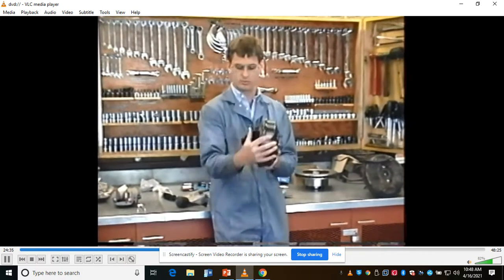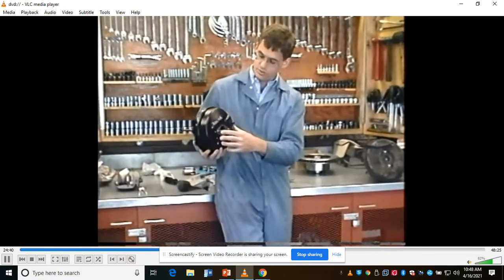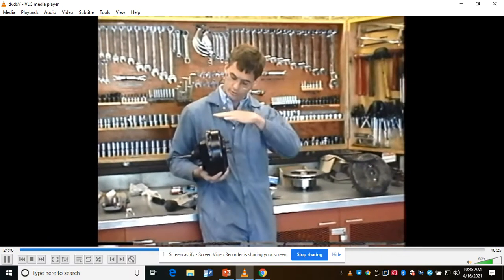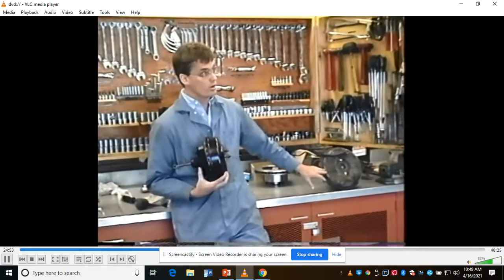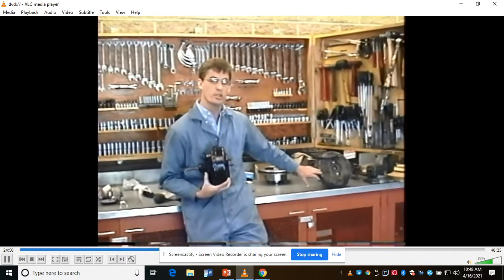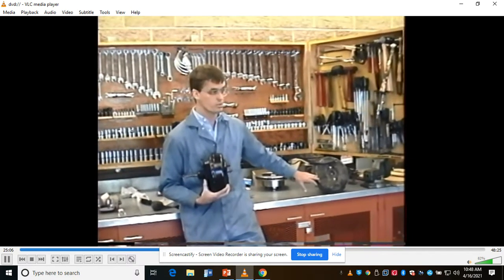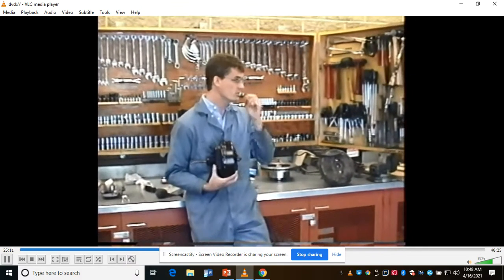The one thing you'll notice about it is this plate where the studs are and it bolts up to the firewall, and these two studs where the master cylinder goes, is going to keep the master cylinder very level. You'll notice that the diameter of this is a little smaller. Okay, so it'll clear the hood. The other thing about the diameter being smaller instead of going with the bigger one: the Novas are light, they're like 2,900 pounds. You take this giant power brake booster, you're going to have a very, very sensitive, touchy brake pedal, almost too sensitive. My friend with his '64 Supersport that has the big power brake booster, I mean, you touch the brakes, you stop now, and your teeth just bounce off the windshield.